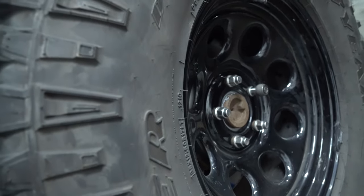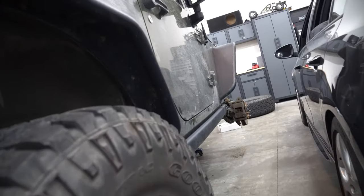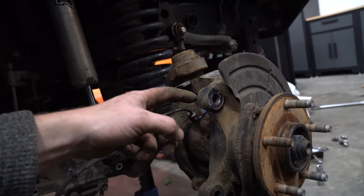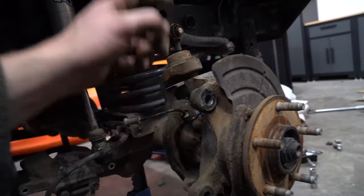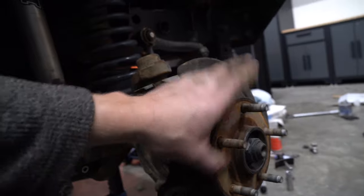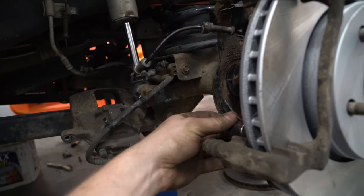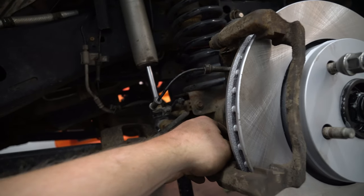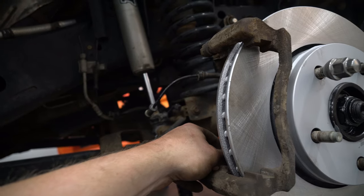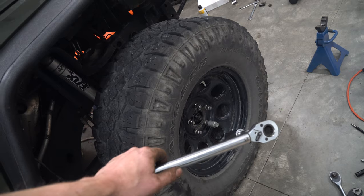After that, go do the other side — exact same thing. I'll tell you what we do differently with the front: unlike the rears, we have 21mm bolts up front. The rotor wasn't seized, which is exactly why we use anti-seize — make sure you have that on there. Use a torque wrench: the rears are 55 foot pounds, which is easy to feel out, but 120 foot pounds is double that and a little more for the front bracket. Once the tires are down, go ahead and torque the lug nuts to 110 foot pounds in a star pattern.